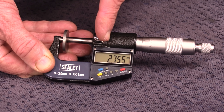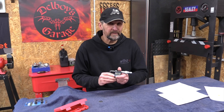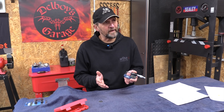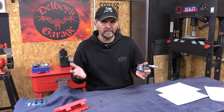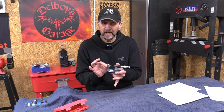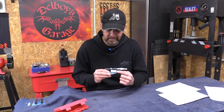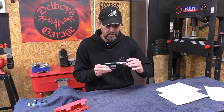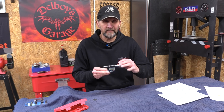That's a 275 and as you can see it measures 2.755 — so it's a fresh unused 2.75mm shim. You need a micrometer for two reasons: firstly, I found three exhaust shims on that engine with no numbers at all — rubbed off or never marked — so there's no way to determine what thickness they are without measuring. Secondly, when you get your new shims, don't trust the numbers — you need to check them. You can get a micrometer for as little as 30 or 40 pounds; I'll leave a link in the description.